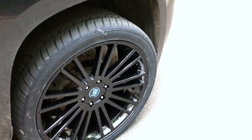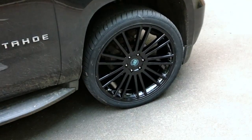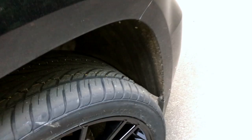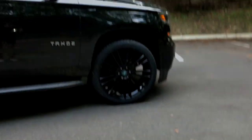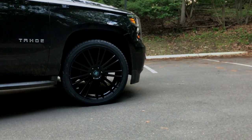I'll link their website down below. If you have any questions, contact them — they're very friendly people and they helped me a lot. I didn't know what tires to get; I didn't know if I should go with 305s, which are just a little bit bigger. They told me these 295 tires are perfect — I don't have to deal with rubbing, and they're the same factory diameter. The sidewall is pretty big; I know people on the Tahoe and Escalade forums say to go with 305s, but the sidewall already looks decent. I did go over a few potholes and nothing crazy happened.